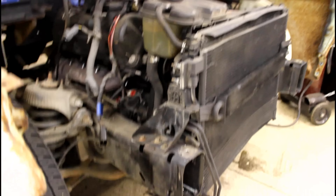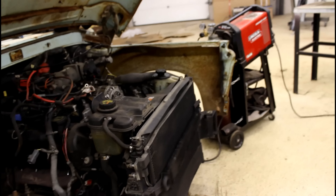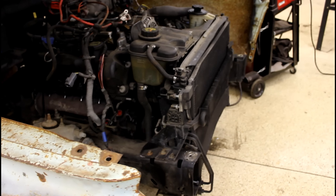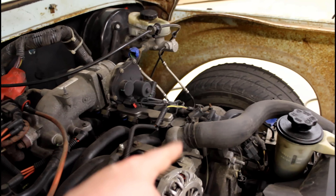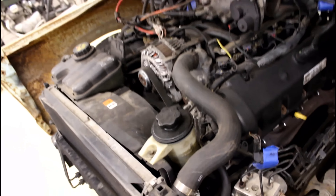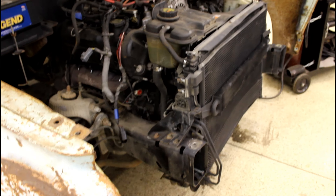I used the same bolts for both that and the radiator cradle. By moving the radiator cradle back, it straightened the radiator more perpendicular there. It's really, really simple. The only other thing I did was I trimmed the upper radiator hose a little bit, because it was going to kink otherwise. But that worked out well — super simple. I always like it when that happens.